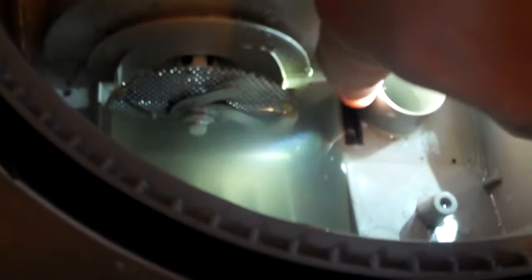There's one more step — a rubber seal thing, a flapper valve. You gotta reach down and get that out. It's located right down there, that black part. Just reach in with your fingers, use your fingernails, grab it and pull it out. It opens and closes — you'd want to check it in case it's not letting your dishwasher drain.